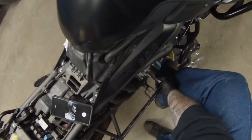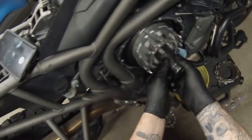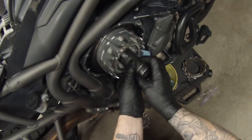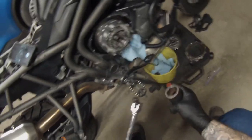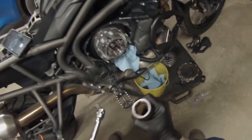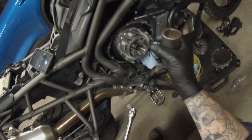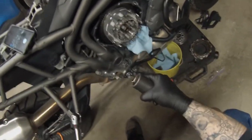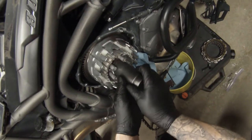I just stood up, put a bunch of pressure on that brake pedal, held the handlebar, and then used the bar and was able to break that free. It's not a huge torque — when you're putting it back together it's 98 Newton meters, so it's not huge. Sometimes I like to look up the procedure before I do it. The main thing I was checking for was that this wasn't a reverse thread — it's not. You go left to loosen. If you're putting a bunch of pressure on it and it's not even torqued to as much as a Honda wheel nut and you can't break it free, something's going wrong.